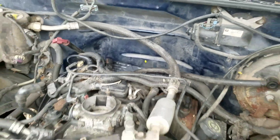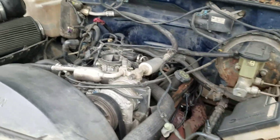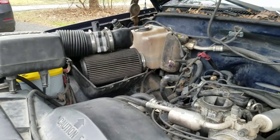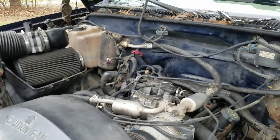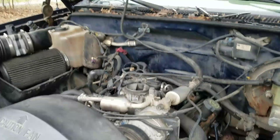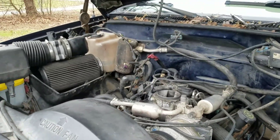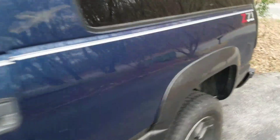Just because I was negative 24 degrees, we'll see what kind of result we get. Also, the mass airflow sensor — you can leave all that disconnected. Chevys in the 90s and early 2000s substituted a known value for their mass airflows when they'd go bad, so it will run without it. Not too concerned about it — let's see what we get.